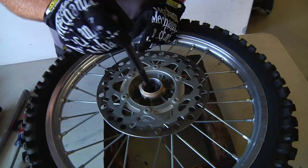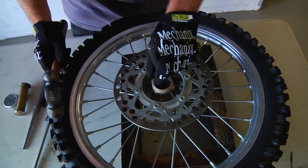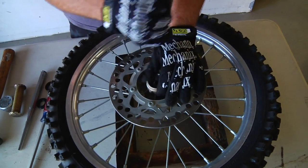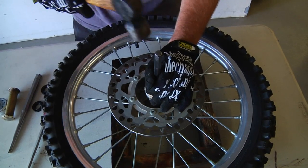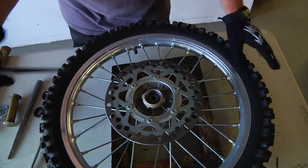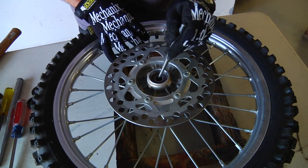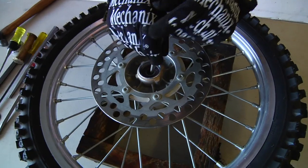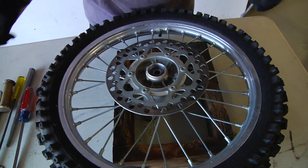At this point we'll have to knock the spacer a little sideways so we can get a bite on the bearing below. We'll do it again on this side. You can feel the bearing — give it a little clip. I found a smaller punch that'll be able to get in here. You can see the bearing is now moving around; we've got it beat to the side. Now we can get right on one lip of that bearing, and we want to switch back and forth sides until we hear it pop out.